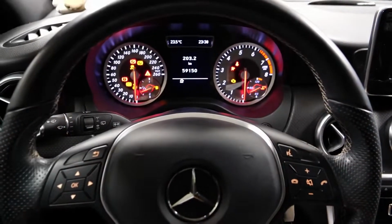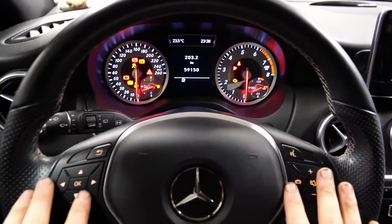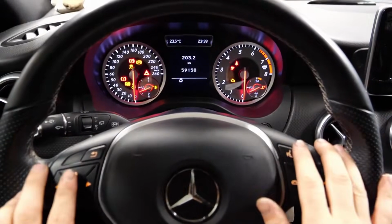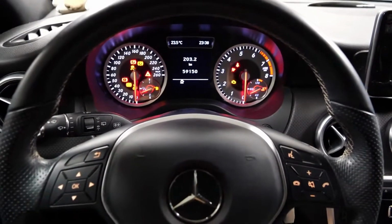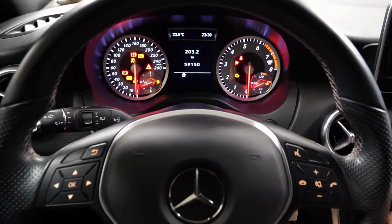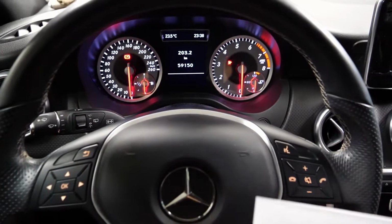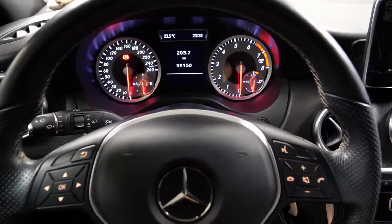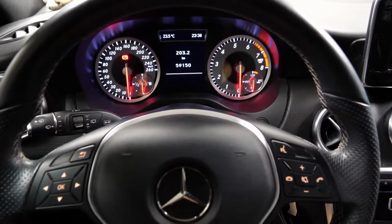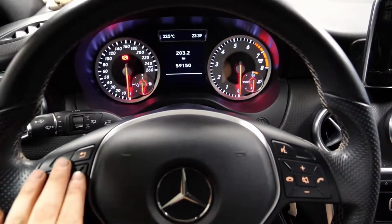So how do we reset the whole thing? It's actually quite tricky for me to film this because it's going to end up looking a bit blurry for you. And I hope it's sharp on the display, so here's what we need to do. Trunk, hood, and doors. Make sure they all stay tightly closed. We need to get into position 1.0. Snap into position 1. Then it's absolutely crucial to adjust the multifunction steering wheel display so that it clearly shows the odometer reading.